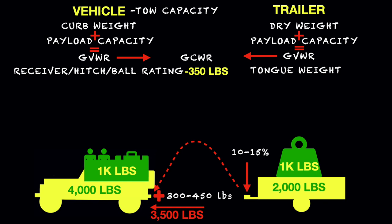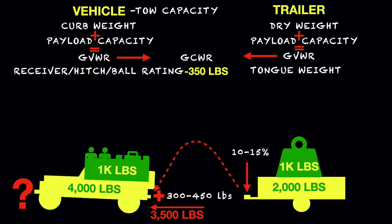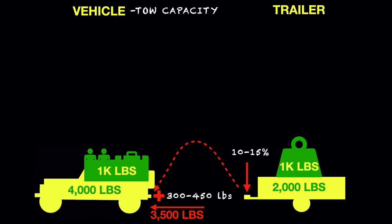The other thing to take into consideration is that excessive weight at the back of the Jeep on the hitch will cause the back of your Jeep to sag. When this occurs, you'd end up with loss of steering control as well as reduced braking capability. Braking when towing all this weight is certainly very important. That's why in the Mopar Handbook, for example, they mention that if you're towing a trailer greater than 1,000 pounds, you should have trailer brakes. Each province and state has their own regulations, where generally they start at roughly 1,500 pounds and some are closer to 2,000 pounds. If you have a trailer that heavy, it requires trailer brakes, and if you have trailer brakes, then you need a trailer brake controller in your Jeep.